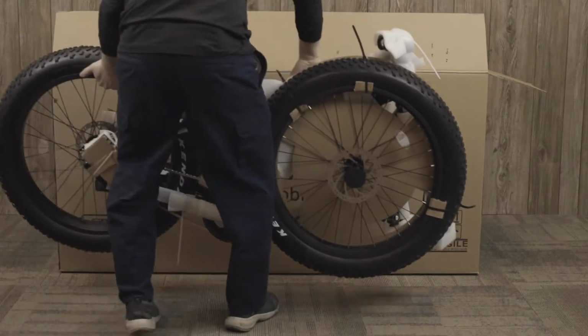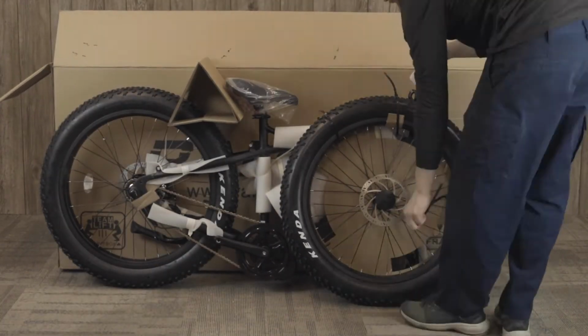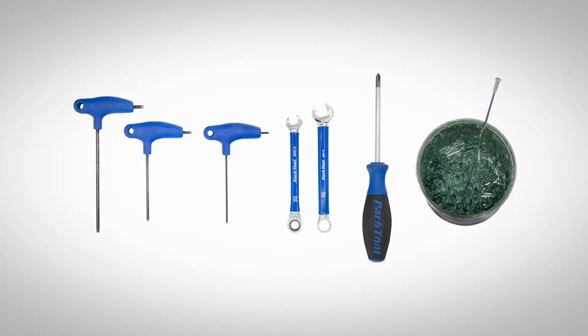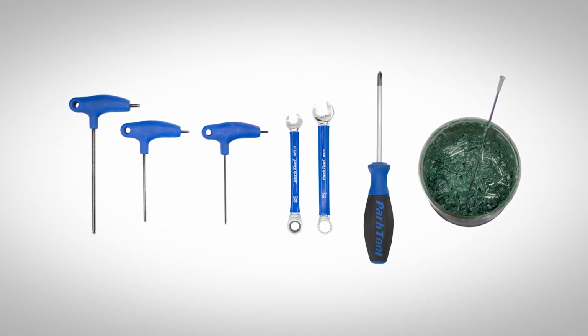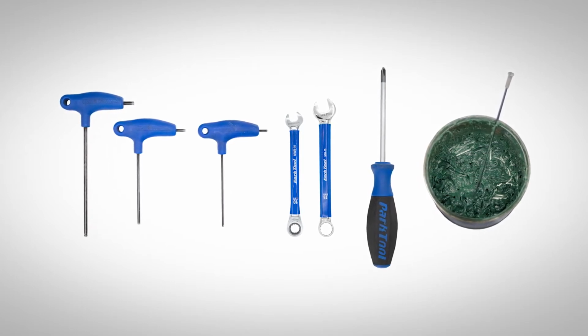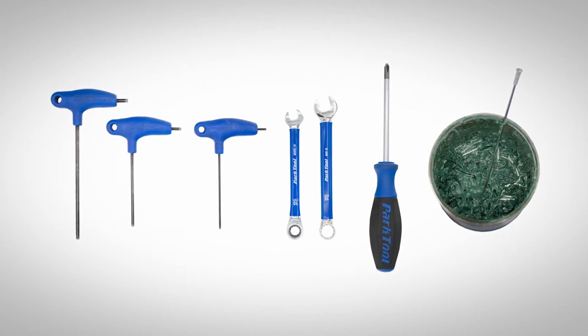First step in assembling your bike is removing the bike from the box and removing all the packaging materials from the bike. The tools you will need to assemble your bike are a 3mm, 4mm, and 5mm Allen wrench, a 10 and a 15mm open-ended wrench, and a number 2 Phillips screwdriver, and some general purpose grease.